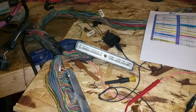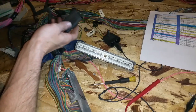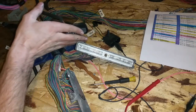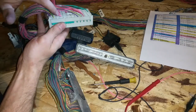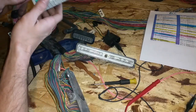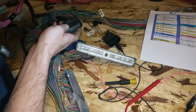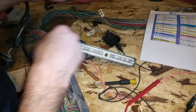I'm almost done working this plug. It does say on the LT1 swap site that basically you're going to cut this plug off, and you're going to cut all the wires off except for the pink wires, because the pink wires are your 12-volt hots that go to different circuits like your injectors and coil packs. But I just want to verify that before I actually go through and hack them all off — so that's pretty much where I'm at.